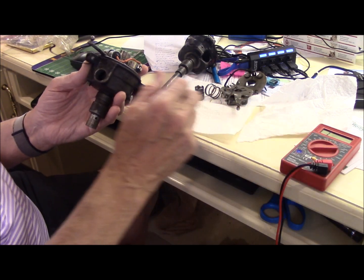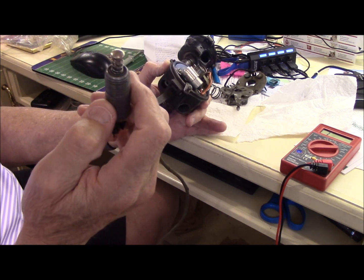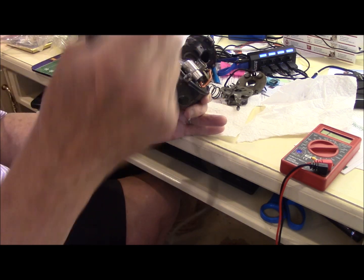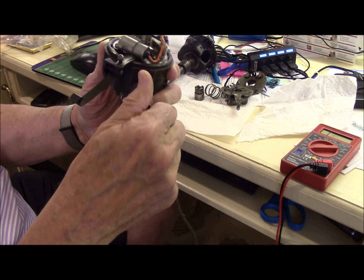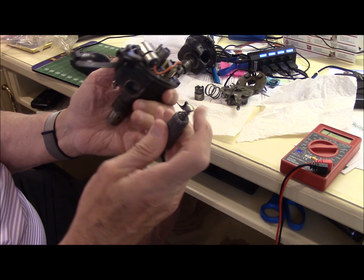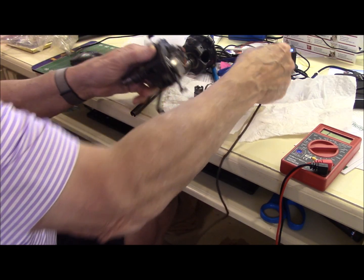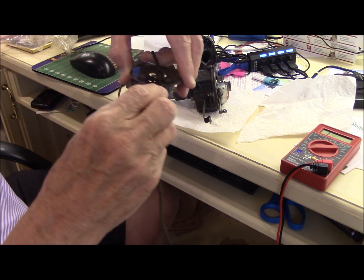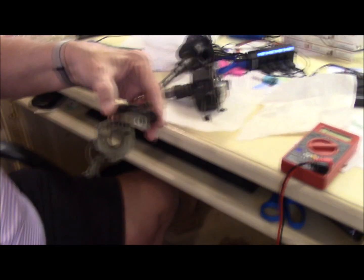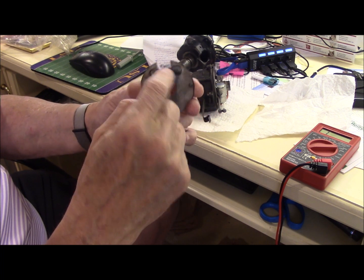The way Henry set it up, he had an armored cable coming from that side of the coil. It goes from the coil up to the ignition switch and back down to that cable, and that big screw-in fitting that screws into the side of the distributor. What that does is take that circuit and touch the member inside there. What is inside there is this — it's the lower plate, and this piece touches that. So now we have that circuit, that wire from the coil, to this part. But this part doesn't touch anything else.